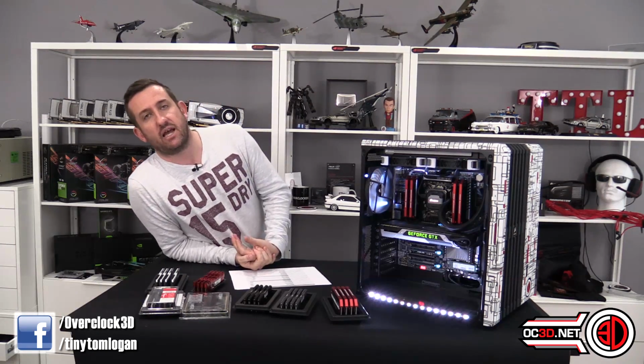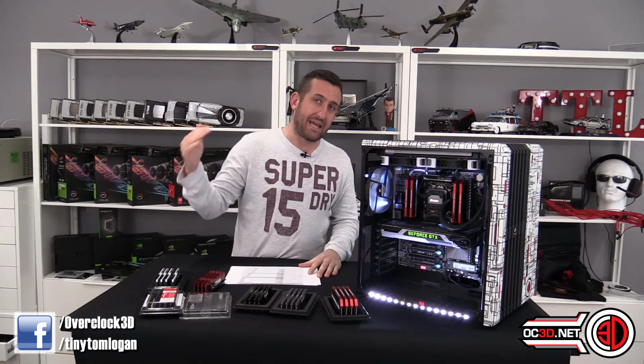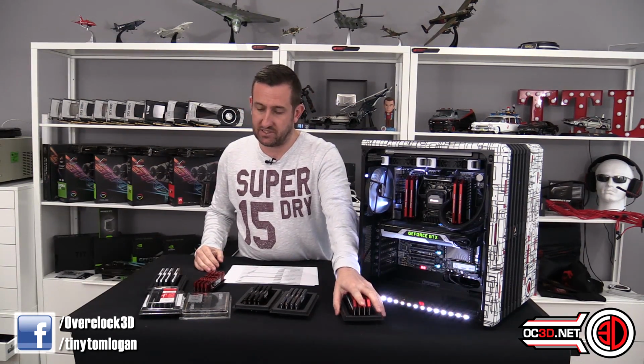It's actually technically a Z170 speed sort of kit. We have got them running on other boards though. We can never get them running at 3600 MHz. We normally have to turn them back to 3400 MHz. That's normally how we go about it. We do it in a kind of backwards way. But the fact that we have a 3600 MHz kit means we can really push the boundaries. So that didn't run, although I wasn't particularly bothered.